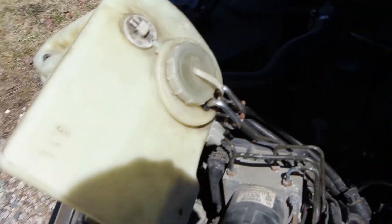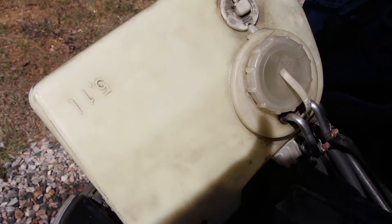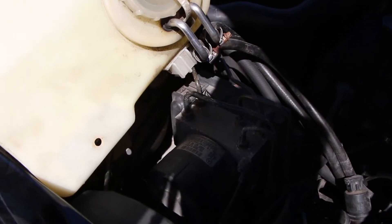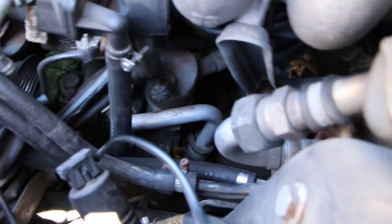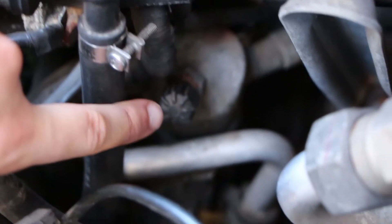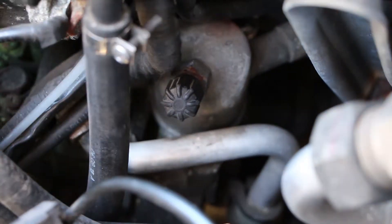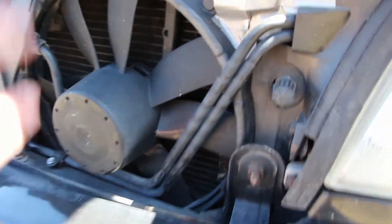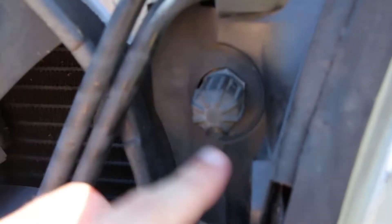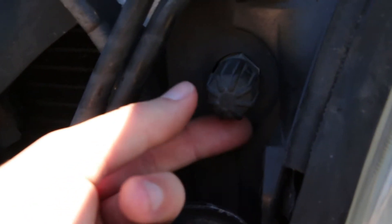For the low side unfortunately you've got to do a little bit of disassembly. You have to drain out your windshield washer bottle and just pull it out of the way. You can leave it connected if you have the heater but you might want to pull the pump out just to set it on the side, and you'll find the low side connection on the AC compressor right there. For the high side connection it's a little bit easier — you have to take out the little plastic shroud covering the auxiliary fans, and your high side connection is right there. Unscrew that cap and you'll be able to attach your gauges.